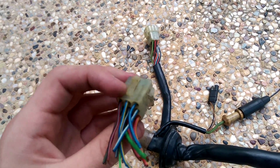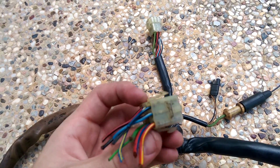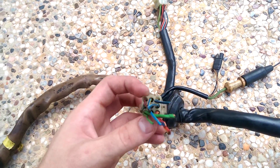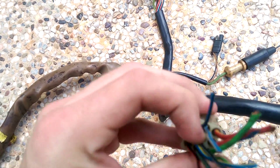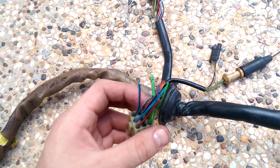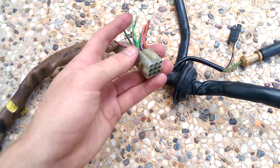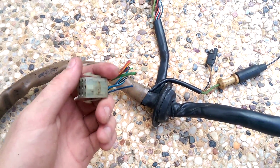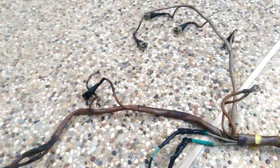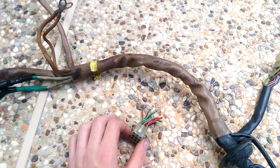Those are some of the major connections. The rest are things like your water temperature gauge — there's that green and blue — and you can see the blue and white and blue and black from the oil pressure sender. The middle one out of all nine is fuel pump power. I'll post a chart in the description where you can see what these all do. Hopefully that was good information for those of you looking to find out more — there's not a lot of objective information available, and I didn't see anything else on YouTube that really had all this in it.